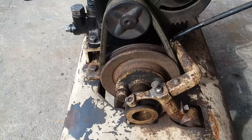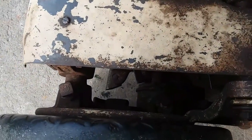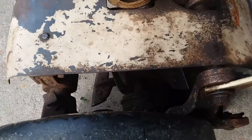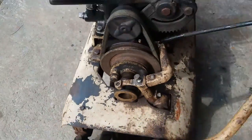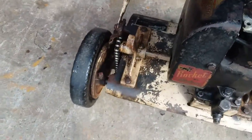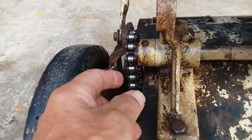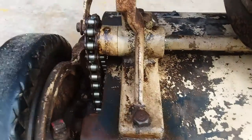The belt is the original belt that was on it. There's nothing really wrong with it — it is old and dry, but it functions properly. There are a number of oil cups on this: one down on the reel shaft, and inside the hubcaps behind the hole on both sides. You've also got a cup on the jack shaft, both inside and outside the bearing block. I took the chain off, soaked it in kerosene, and then lubricated it — it's fine. The sprockets and chain are a little worn, but when you're almost 70 years old, you'd be worn too. Beyond that, everything else is original.